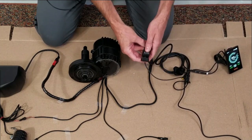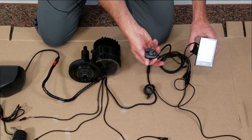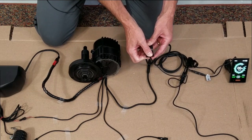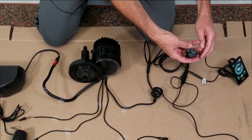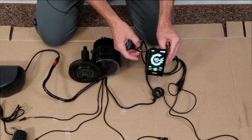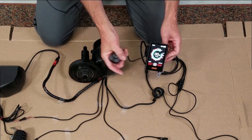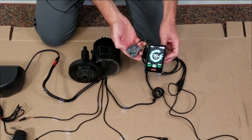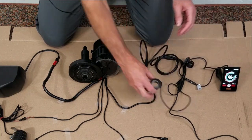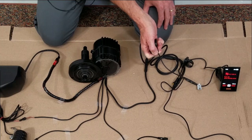At this point I should be able to take my throttle. So that's level three. Let's back it down to level one — you can see I'm going to go full, just a slow spin. Let's go up to level five. This display, the DPC-18, can go to nine levels — you can have three, five, and nine. It comes standard with five. We can also switch it to sport mode by holding the plus key down. So I'm in eco mode now going to sport. This is going to give me max speed on the throttle. It doesn't look different, but that is moving quite a bit faster.